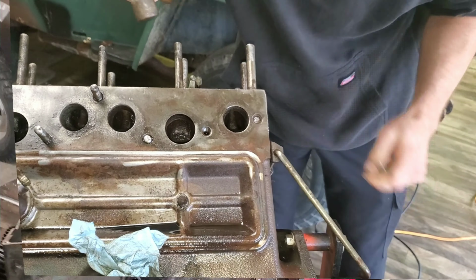All right, y'all. So where we are at, as we have done every drill bit we can, we need the appropriate size. We've gone to the largest easy out we can, and he is going with a tap and a hammer. Just as you were talking, I broke the last little bits out of it. It fell down in the water jacket, though, somewhere. Maybe we can flush it out. We'd probably just have to clean these threads up, maybe. Yeah, because there's a water hole up top, too.